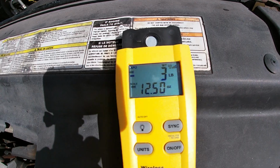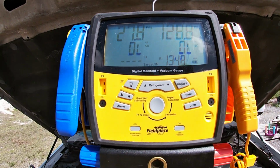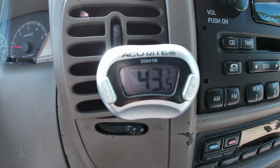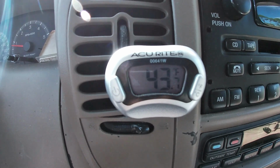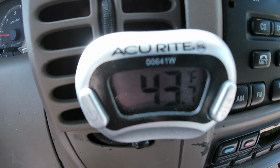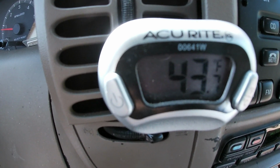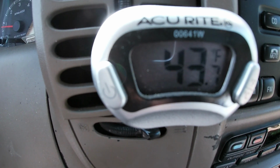When I was done with this system, when I recharged it, I think the coldest I got it down to was about 37 degrees. It shows 43 here, but I didn't record the rest of the video. I'm trying to keep it short, but I got it down to about 37 degrees. And that's all. This was due to that orifice being clogged.